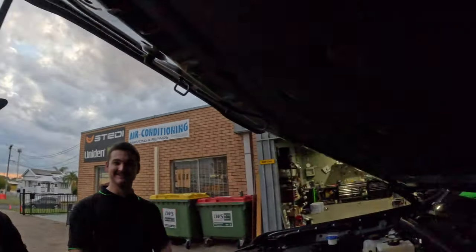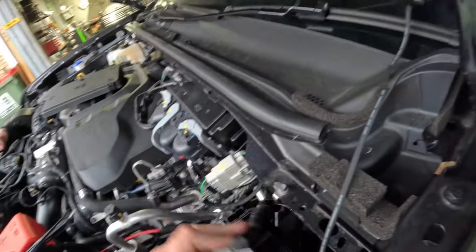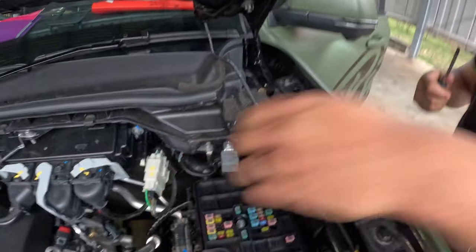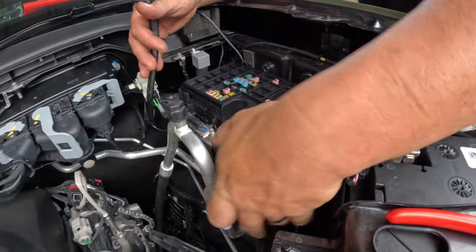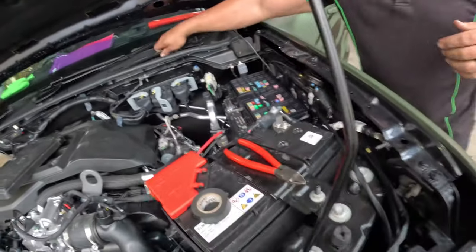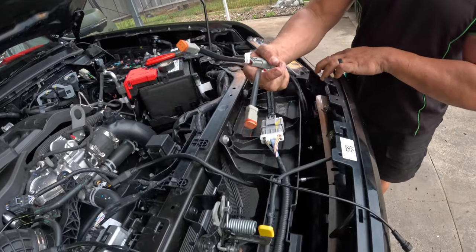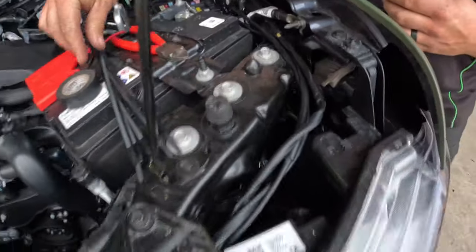The sun is going down, so let's get back to work. Now we're going to mount the relay. There's already a hole right there — that's where it's going. We get a bolt to fit that, line it up, and Robbie puts the bolt in. Once we've got the relay bolted in with the nut and bolt that's supplied, we need to run the wiring harness. Wiring comes down off the relay, around the side of the fuse box — we've got two for the light bars and one for the battery. Remember, the battery goes on last. We run the cables around the side of the battery, through behind the headlight, and pop them out right behind the light bars, ready to connect. There'll be a bunch of zip ties in the kit — just zip tie everything off and cut the ends nice and tidy.